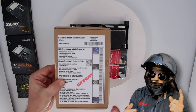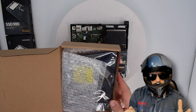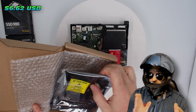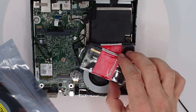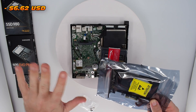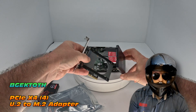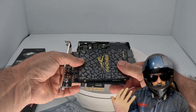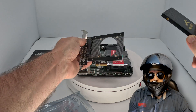Next key component — we need to be able to upgrade our machine. This one's quite unique: it's actually a U.2 SSD adapter. I'm not going to use it in this build, but you can totally run these in your server. It's a really good adapter — the Berichthoft, funny name. It's a U.2 SSD adapter, basically an NVMe conversion from M.2 to U.2, the enterprise grade interface.